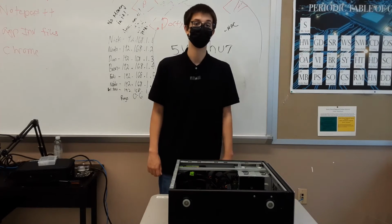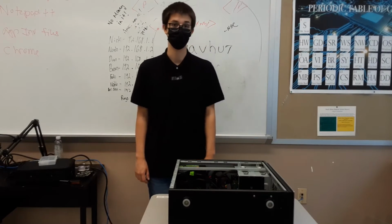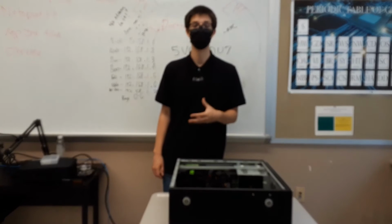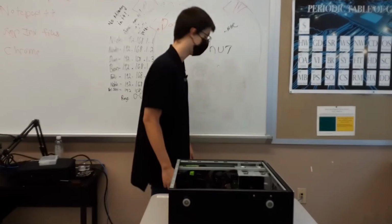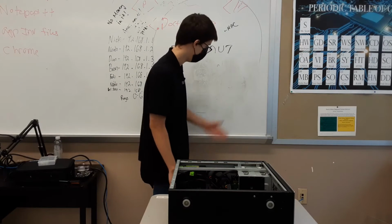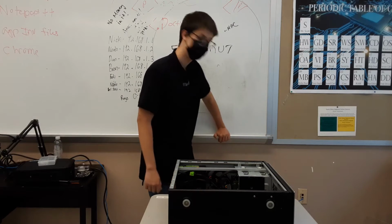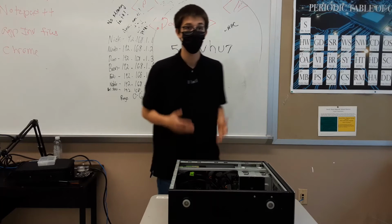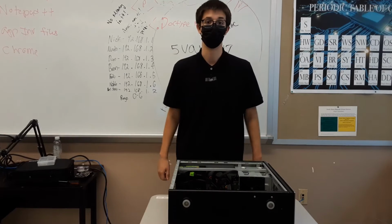Next thing you're going to want to do is go ahead and discharge your static electricity. Your static electricity can fry your components if you touch them while you are statically charged. So what we're going to want to go ahead and do is just touch some metal. Now we have some metal right here on the whiteboard. Go ahead and grab that. Now metal is conductive. It'll take my static electricity and I'll be okay to work on my computer.